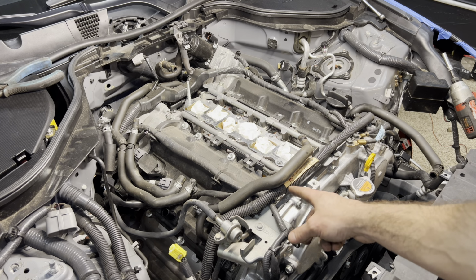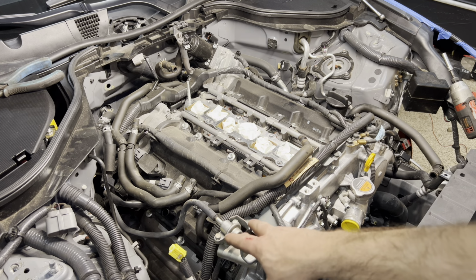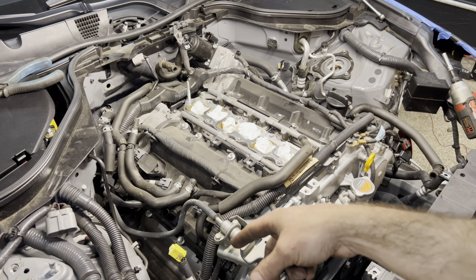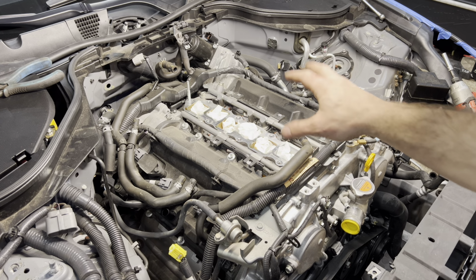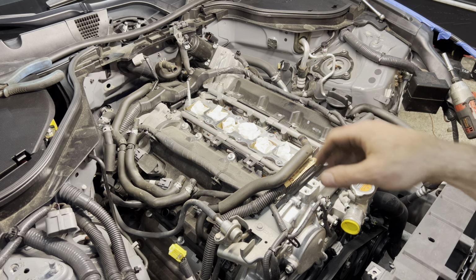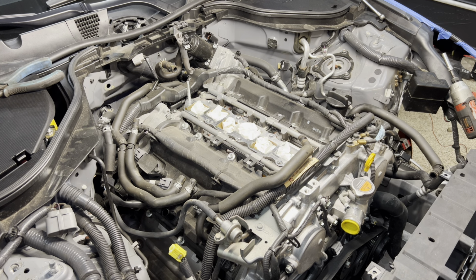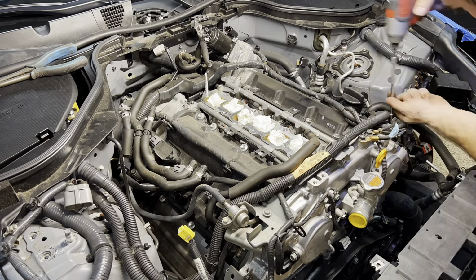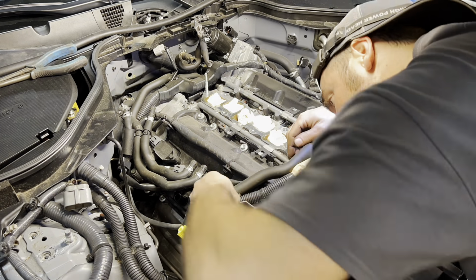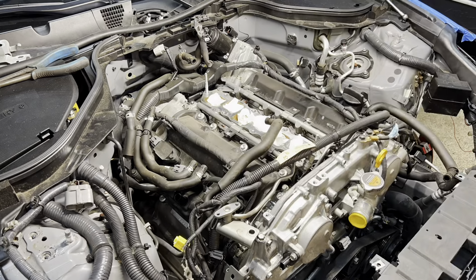So this goes underneath this bracket into both rails. Right now what we're after is disconnect this, pull the rest of the line all the way through, remove the lower, and then plug all the ports on the cylinder head. We're going to start building the rails. We're going to start on the fuel system. So right here you'll see this is just removing the rails, because obviously we're going to have to move the factory rails to get our new ones in there.